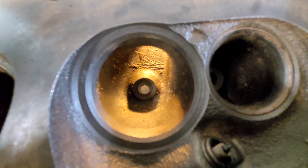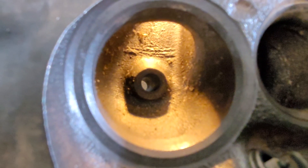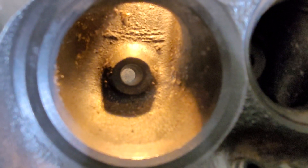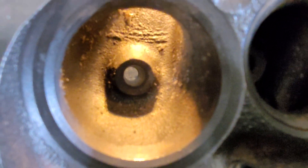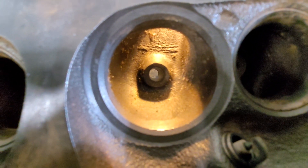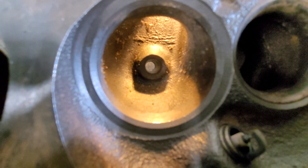Here's the stocker — there's all kinds of garbage in the port, and some of the stuff stuck to the sides is from the port molds. One port that I started porting — they must have dropped the mold when assembling it — because the roof had at least an extra hundred thousandths of really nasty jaggy iron, about 350 thousandths thick on the roof. These are nice and heavy castings, as heavy as the GT40 Ps.